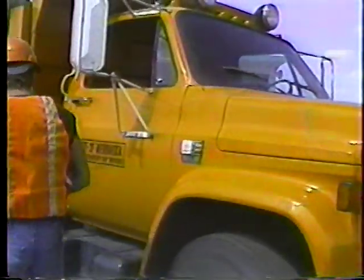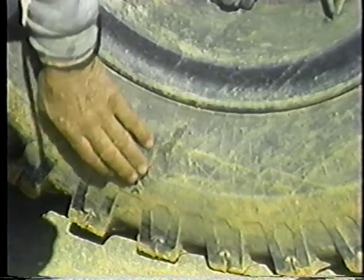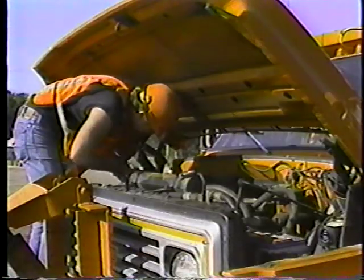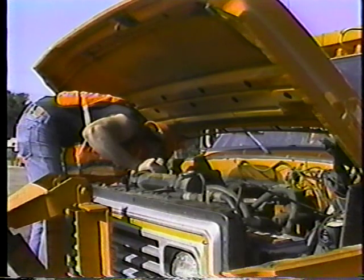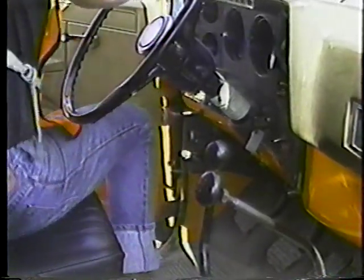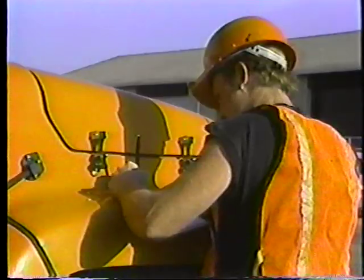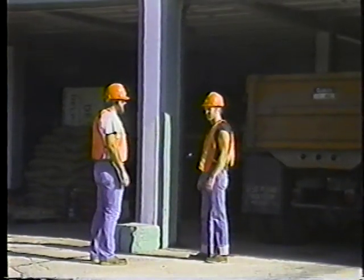Do a quick walk-around inspection and look for any damage that may have occurred during the day, such as a gash in a tire. If your truck has an automatic transmission, check the transmission fluid level at least once a week while the engine is running. Shut down the engine after it's cooled down — put the transmission in first or reverse (on automatics, leave it in neutral) and double-check the parking brake. If there's any doubt about the vehicle staying put, block the wheels. Check the power steering fluid while the engine is still warm, and remember: don't overfill any fluid level, as adding too much is usually as bad as not enough. Make a note of any problems or damage and report them to your supervisor.